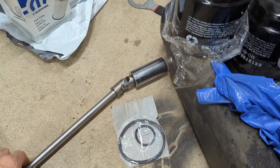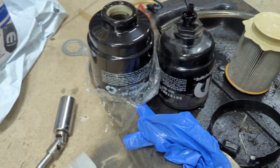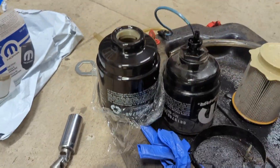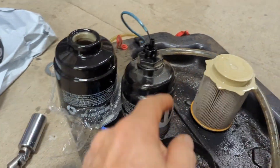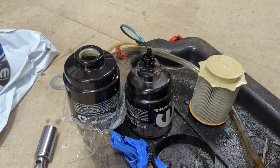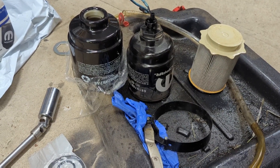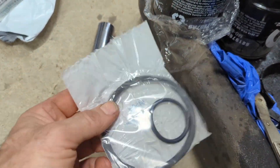So these are some tools you'll need, or what I use. I use a socket that I can angle to get the paper filter lid off. I use this to take the water separator off. You just unclip this, put this around it, loosen it up. Hook your hose to this, open that valve to drain it. Make sure you have a catch pan to catch the diesel fuel that comes out. Loosen a little more once you get most of the fuel out. I always put a rag under there to catch any that might spill. And you just take that all the way out. Don't forget to lube up your rings again.